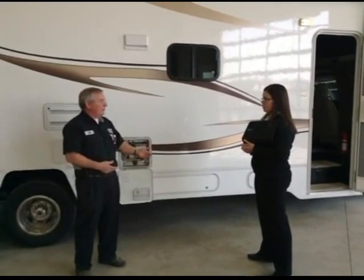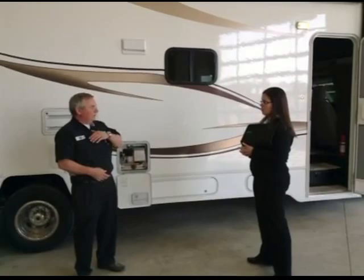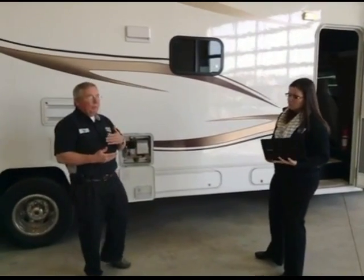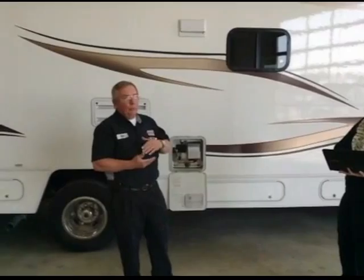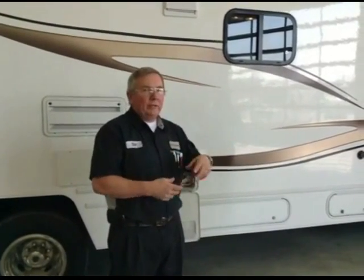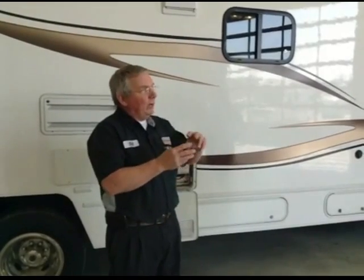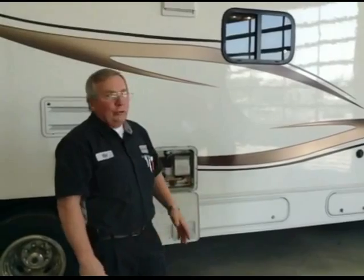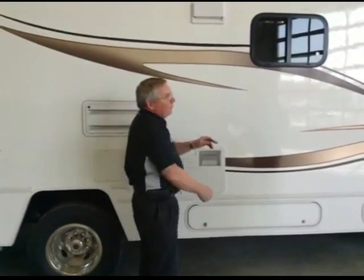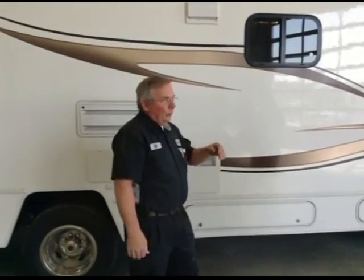It's a lot like the AquaHot. If you have an AquaHot system, you're just going to run the hot water until you get all the antifreeze out. And another thing with the AquaHot, and I know we're de-winterizing and not winterizing, but they've told us many times that if you're using air to blow out your systems, on the AquaHot systems you should always put antifreeze back through, because if you're using the heat, it leaves those plastic tubes exposed to too much heat without any water to absorb it. So they really do want you to leave the antifreeze in the AquaHot when you winterize. Okay, good to know.